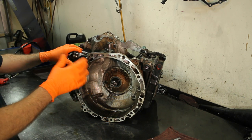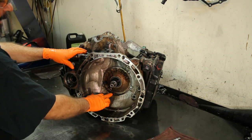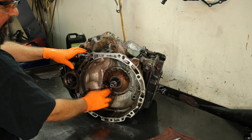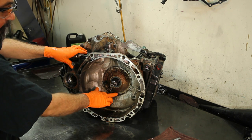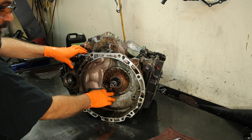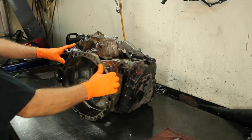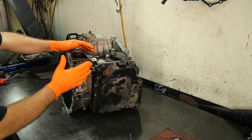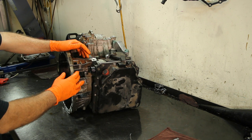As you can see here, they probably added some type of additive. This is the pump, and it has a pump o-ring. I can see right here that it was leaking out of the pump o-ring — leaking out the front. The fluid looks kind of weird coming out of there. I'm not sure how many miles are on this car. I told him to send me the trouble codes to give me an idea of what's going on with this unit.